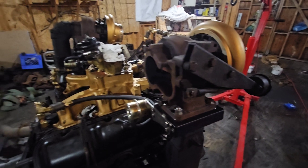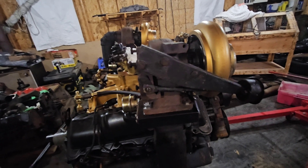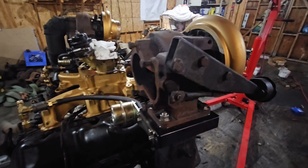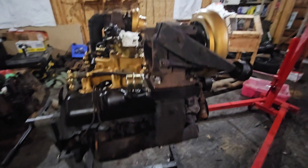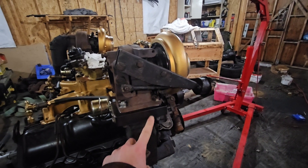The v5 version of the twin turbo setup is addressing a lot of the problems from the v4. The v4 had major turbo lag — basically really bad turbo lag — and a couple little things I'll get into in a moment. To address the turbo lag, I got these quick spool valves, which close off one side of the turbine housing on the turbo.